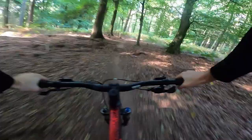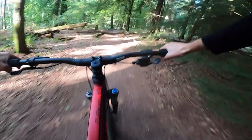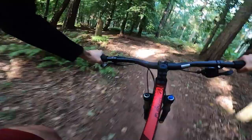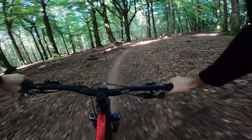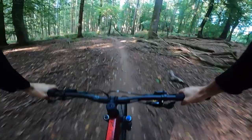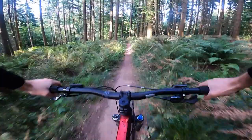This bike has some upgrade-ability. You can put in a tapered steerer fork, because the one at the moment is straight inch and eighth — that'll probably be something you want to do if you decide to upgrade your fork in the long term. Not an immediate need. The back end of the bike, however, does still have a quick release, not a through axle, which means you might struggle to find more quality upgrade wheel sets. But the stock one isn't too bad. It doesn't say it's tubeless ready, but I reckon you could have a good crack with some tape and valves on your own.